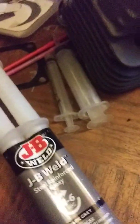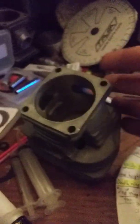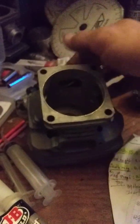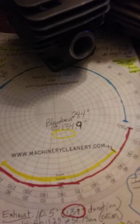But some JB Weld — I had never done this before — you raise the intake floor by quite a bit, then re-carve your entire intake port to your liking. You just have to prep it, clean it, make sure you understand proper prep for bite and proper cleaning. Problem solved: no piston rings make contact with it, no big deal. You can change the ridiculous piston intake duration by changing that.